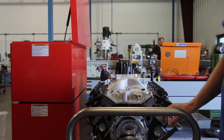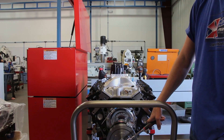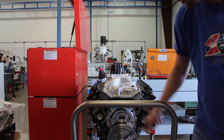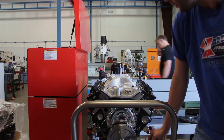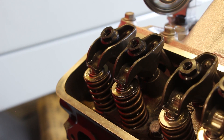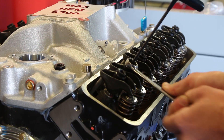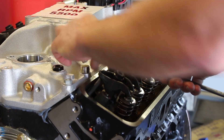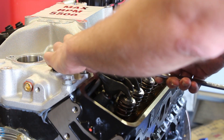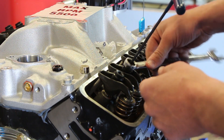The trick to the hydraulic lifters is to find where the push rod is at zero lash. We'll start with number one valve — roll the engine around until the exhaust valve just starts to move, and that tells me I can set my intake valve. So we'll grab some wrenches, back this off, loosen the center locking nut, and then loosen this rocker until the push rod starts to move. That tells us the tension is out of it and we can set it accordingly to get the preload right.